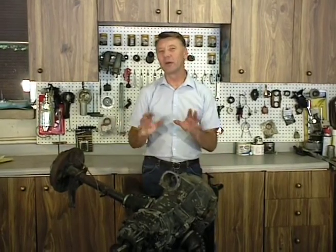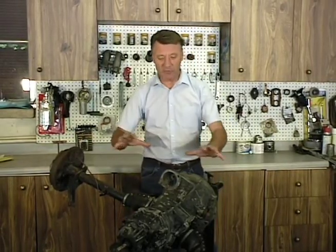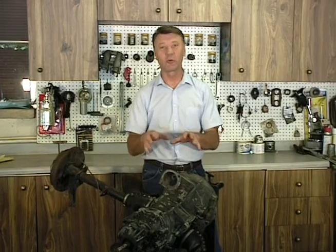Rick Higgins here again. In this video, we're going to R&R — remove and replace — the transmission. We're going to show you a lot of the things on the outside of the transmission that can be taken care of along the way. In another video, we'll get inside the transmission and show you what all those gears and synchronizers are for. We're changing the transmission in this '68 Bug — it started making a roaring noise going down the road, which is a good indication of a bad pinion bearing or even a bad ring and pinion. That's expensive to fix, so the owner has found a good used transmission we checked out, and we're going to put that in. This should give many more miles of good service for about a third of the cost of rebuilding. That's the choice many of you will make, so that's why we're doing this video first. Let's get started.